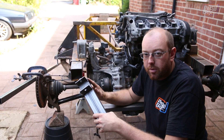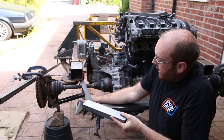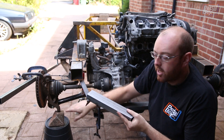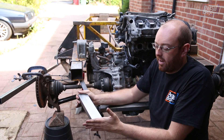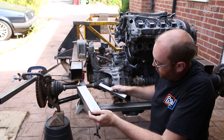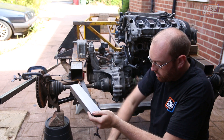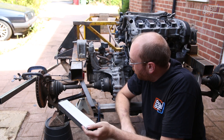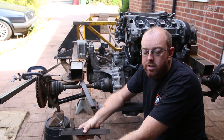We've got one of our stays here with the bracket tack welded on the bottom. We're pretty sure we know where it goes, but before fully committing we'll check a few things first. Once fitted, this will be set up to take lateral loads coming out of the radius arms — the trailing arm takes fore-and-aft, suspension takes up-and-down, but the radius arms put load sideways. We don't want this to flex on a single weld, so we're making a couple of braces — one joining near the differential, another across the top joining the chassis leg — creating two nice triangles, and probably also joining forward into the back of the chassis for an extra contact point.